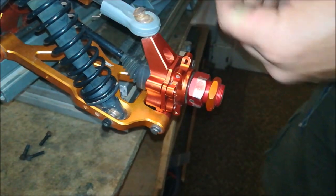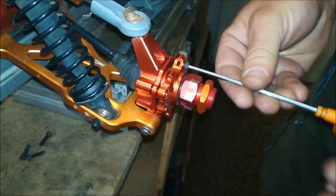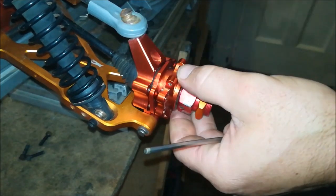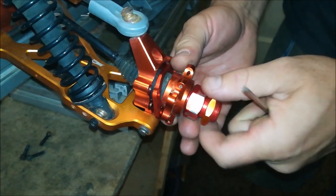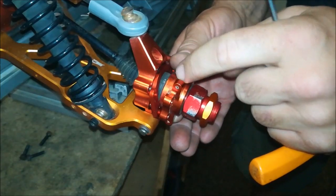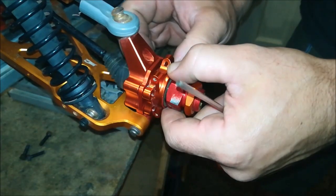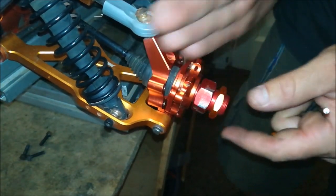Let me quickly explain. This spacer — I'll strip it out here and show you the three parts. You've got the front part of your rear hub carrier, which is the bearing carrier. Both your bearings run in here, and your shaft goes through those two bearings. Then you have the spacer area, and then you've got the main carrier at the back that it screws into.